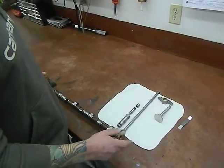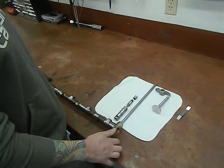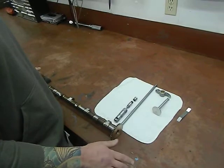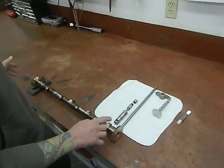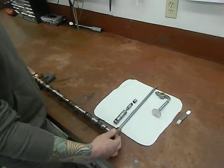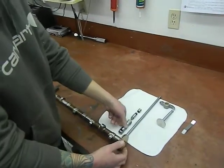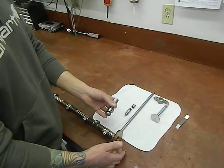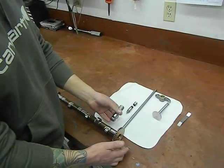When you're checking the cylinder, you want to make sure that it's at top dead center compression, so that there's no pressure whatsoever on the valves. When you're turning the engine, the actual cam lobe at top dead center compression is going to be facing down, so you're not going to have any pressure whatsoever. This is a roller setup, but it doesn't matter if it's roller or flat tappet — it's the exact same fundamentals.